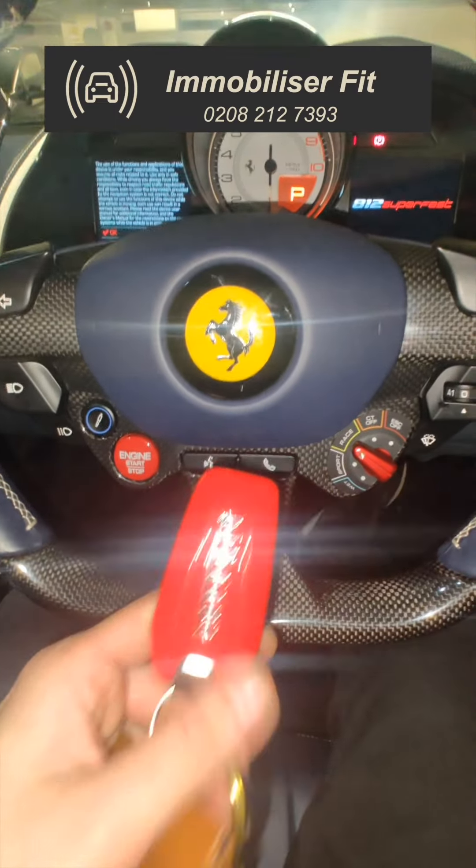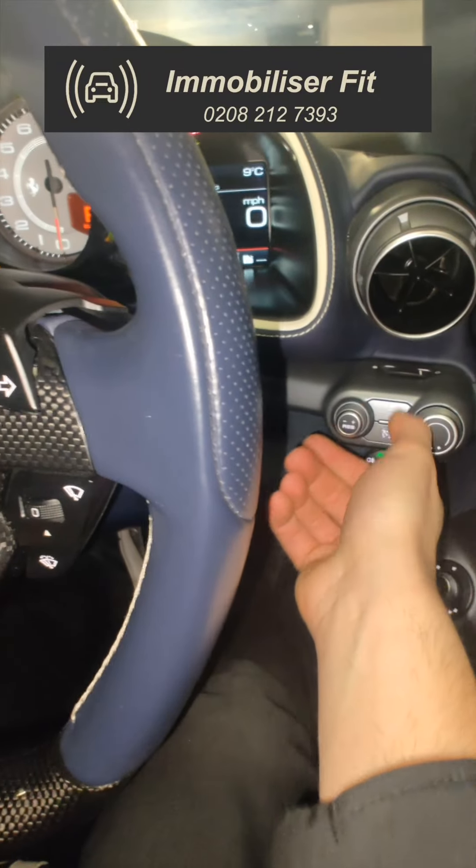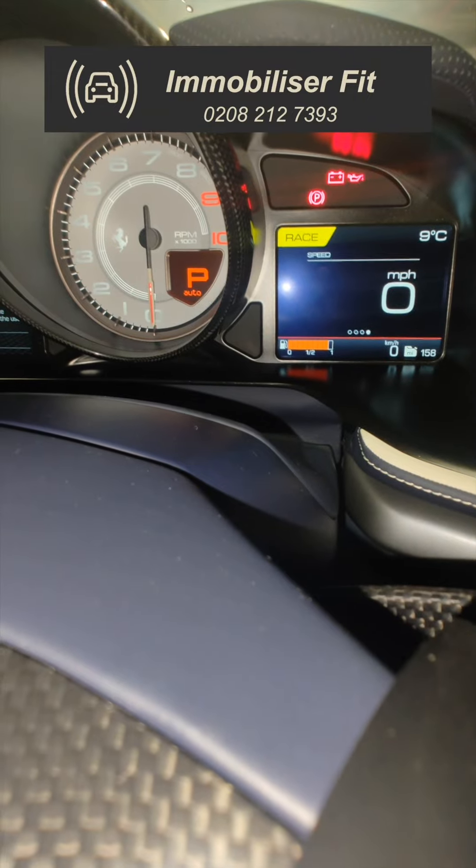If the customer wants to start this vehicle, what they'll do is press and hold, turn the ignition on, and go for a unique code. For now we just have a simple 1, 2, 3, 4 — and you watch the cruise control, we get a double flash.